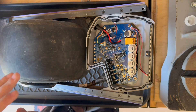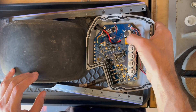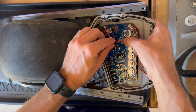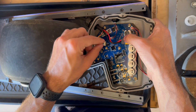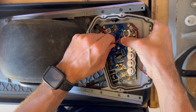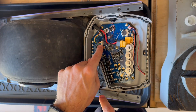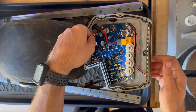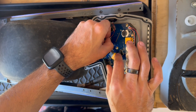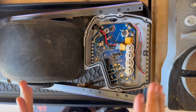Next I'm going to remove the XT60. I like to put my hand on the underside of the enclosure, thumb on the male side of the connector, lightly grab the wires for control so nothing bangs anything, then push with my thumb carefully until it pops out. Next I'll disconnect the data connector — that's the one with the colorful wires — squeeze the tab and pull up. Then the power button connector: squeeze the tab, pull up. And the LED light bar connector: squeeze the tab, pull up. So all four of those are now removed.